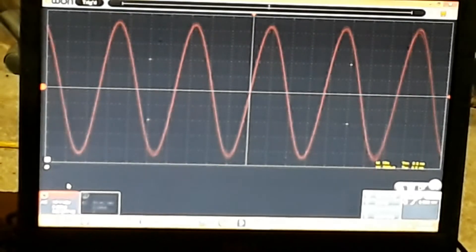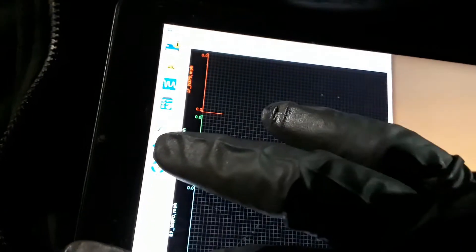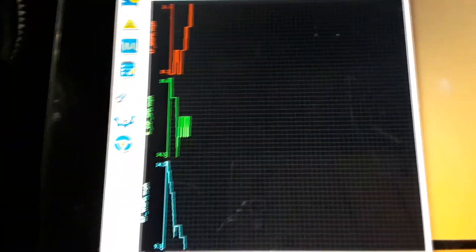It just changed gears. Hey, the ABS light's out! Let's go ahead and scope on this program. Hit play. What is what? Bottom in blue is rear differential. The green is the right front. Red is left front.